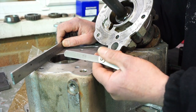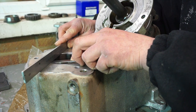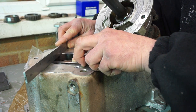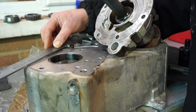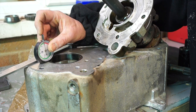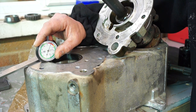On the main part of the casing, the bearing race when fitted will be one millimeter below the face. They recommend using a feeler gauge, but that's obviously too thick, so instead we use something like a tire depth gauge — and that is about one millimeter.